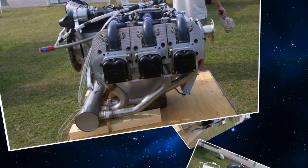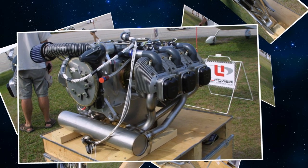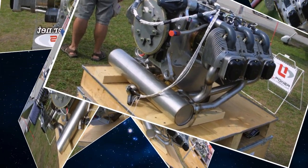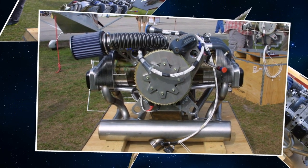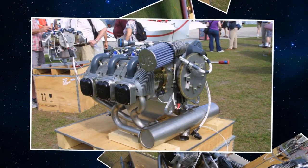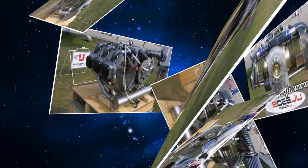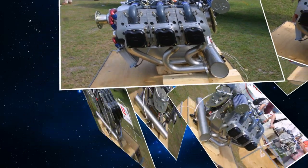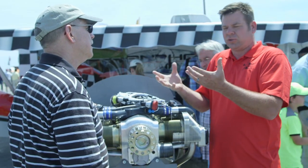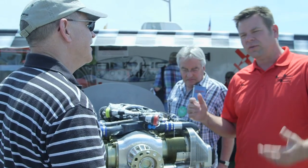You mentioned a universal cowl — what does that mean? We have a universal cowl that fits the engines that are deeper, like the Lycoming, Continental, and the UL engines — they even have a six-cylinder engine. The Corvair is particularly thin, as is the Jabiru, so all other engines use the bigger cowl. That gives us basically two cowls: one for the Jabiru and Corvair, and another for the UL and Lycoming. It also has various scoops that bond on the bottom depending on oil cooler or induction, so we have one master cowl with three or four different induction systems for Lycoming.